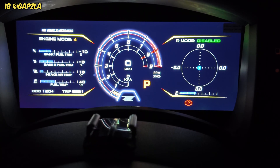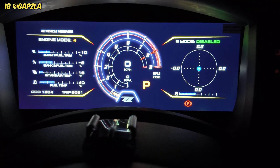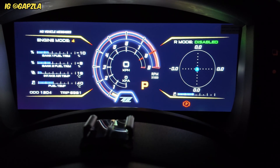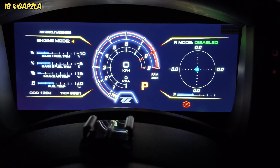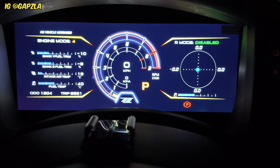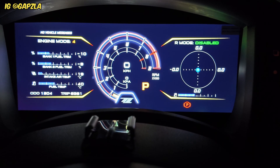You do get a couple of extra features on a digital dash that you don't with an analogue cluster, and there are a couple of extra things that you can actually run which you can't do through the standard MFD or the standard dash. One of those is a fuel pressure sensor. While you can run it on your standard ECU, you can't actually read or display the pressure sensor output. With a digital dash you can see it live on the go, rather than having to log the data and review it after runs.